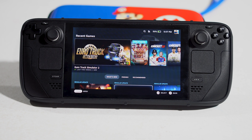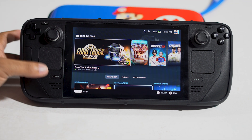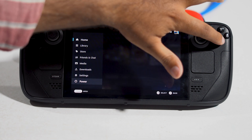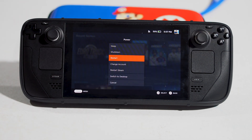The first one is a basic step — you have to do a restart on your Steam Deck. You can do it in two ways: either press and hold the power button for three seconds, which will bring up the menu I'll be showing you now, or press this button, navigate to Power, press A, and go to Restart. After restarting, for many users this did work, so try the restart as the first fix.